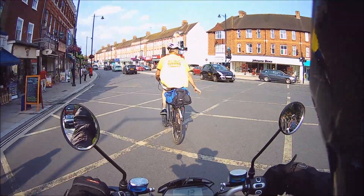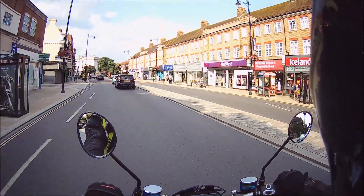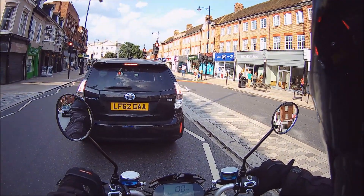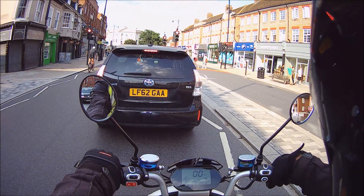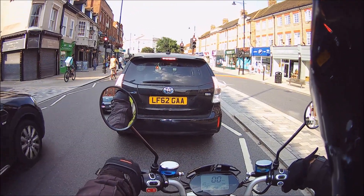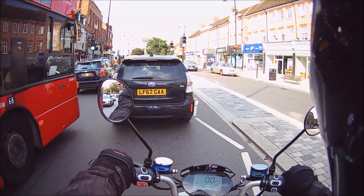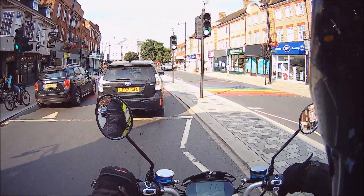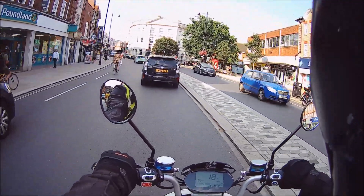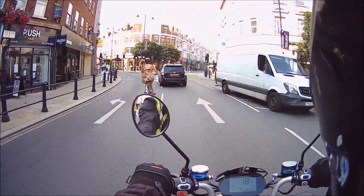This one is a 1200 watt base model, and they've still managed to get a Bosch motor in it for the £1,700 price tag. On the motor it says 1.5 kilowatts. So: 1,200 watts base power, 1,500 watts nominal continuous power as shown on your V5, and 2 kilowatts maximum power. That's about 2 horsepower nominal and just under 3 horsepower max.